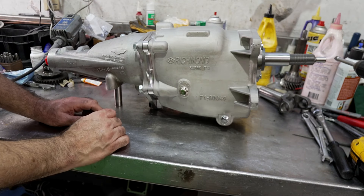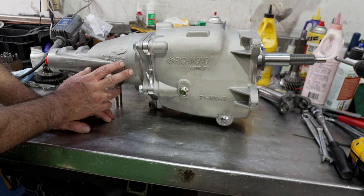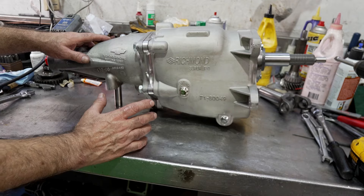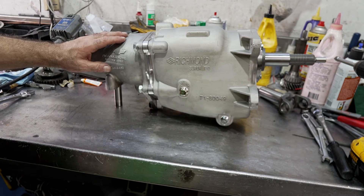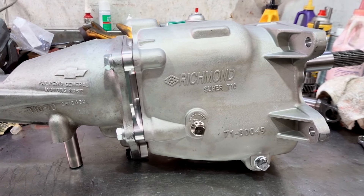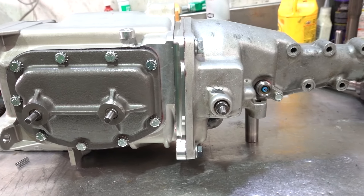So here we have the completed transmission. You've got the Richmond Super T10 main case, brand new billet mid plate, early 60s extension housing coupled to a 27 spline output shaft, 26 spline input shaft, with a brand new Super T10 2.88 gear set. This whole transmission will go in any C1 Corvette, fit perfectly inside it, and the shifter will come out in the right location - you could use your OEM shifter or a brand new Hurst shifter if you like. A nice easy conversion going from a rusty crummy early T10 transmission to a modern day four speed that shifts great and gives you the ability to have better gear ratios. You could run a 3.08 rear in that car, have the advantage of almost a five-speed transmission, and yet have a great first gear for good sporty acceleration and a wonderful enjoyable ride. Thanks for watching, see you soon.